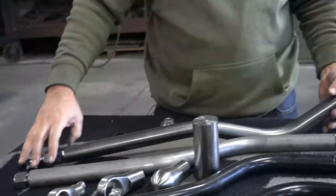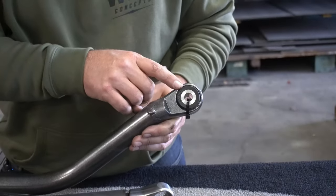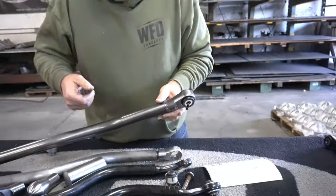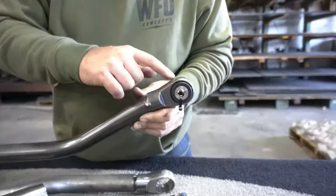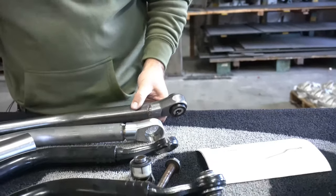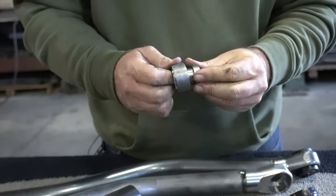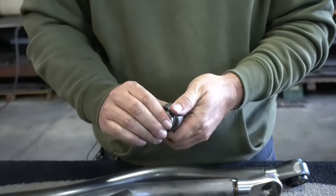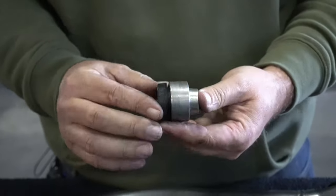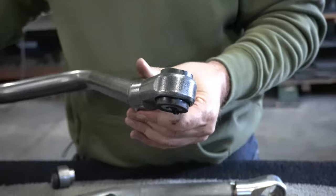This is where you get your adjustability for your lift kit. Up on the other end, this is key as well. The finished one has a wobble stop in it, because if the track bar twists when it's in the Jeep, that's where you start having interference with the differential, drag link, and other issues. We had these polyurethane wobble stoppers made — there's a thicker and a thinner one that go on each side in a specific way with our misalignment spacers in that uniball. The polyurethane basically slides on the outside on each side and wedges it up into the pocket of the track bar bracket so this track bar cannot twist or move.